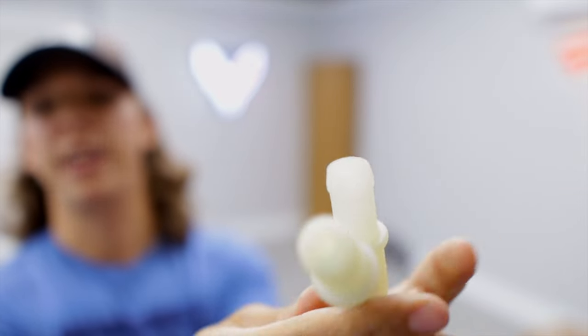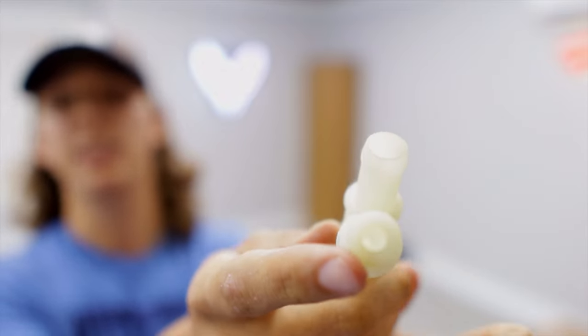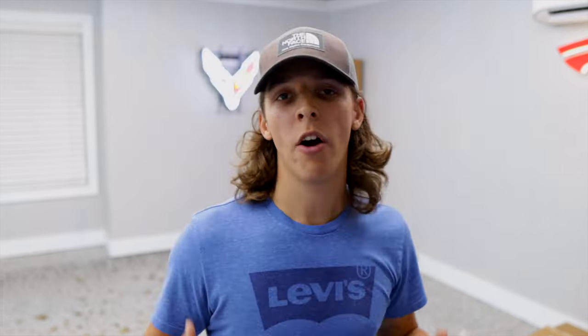Once we have this plastic fitting out, we're going to want to drill out this hole that originally went to the intercooler — you can see it's choked down pretty bad and we want to increase the water flow. Using a 21/64 drill bit, we're going to drill it out, and you want to make sure you get a nice clean hole — don't drill too far and puncture through the other side. You can keep an eye on how deep you're drilling by looking through the largest hole in this fitting, which will prevent over-drilling. Once you finish drilling, make sure this is thoroughly cleaned out because you don't want to send any plastic shavings through the water passages in your engine block. Reinstall it by reversing the steps you took to get it out, and nothing else needs to be done to this fitting.